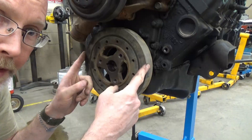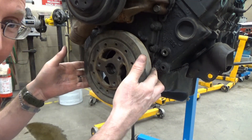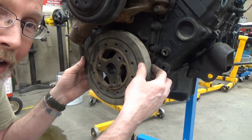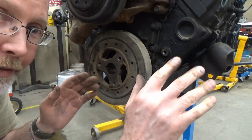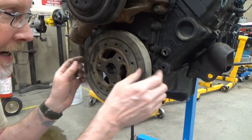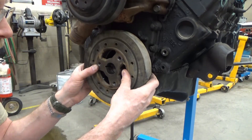This outer piece is glued to the inner piece. If you try to grab the outside of the harmonic balancer and pull it off from there, you will pull off just the outer ring and it's junk — you'll have to buy another one. So never, ever grab it from the outside. Grab it from the inside using these bolts. That's how the harmonic balancer comes off properly.